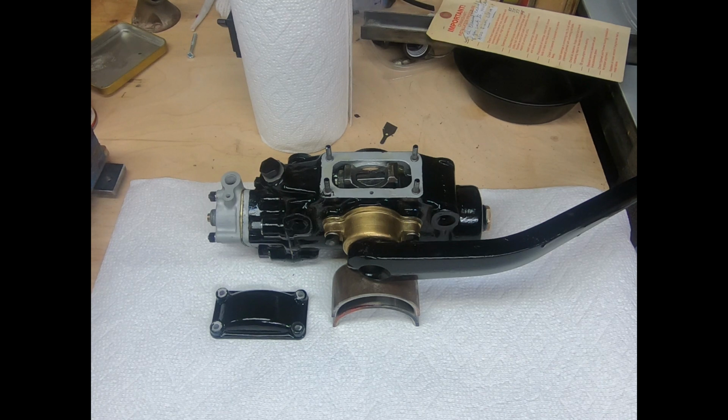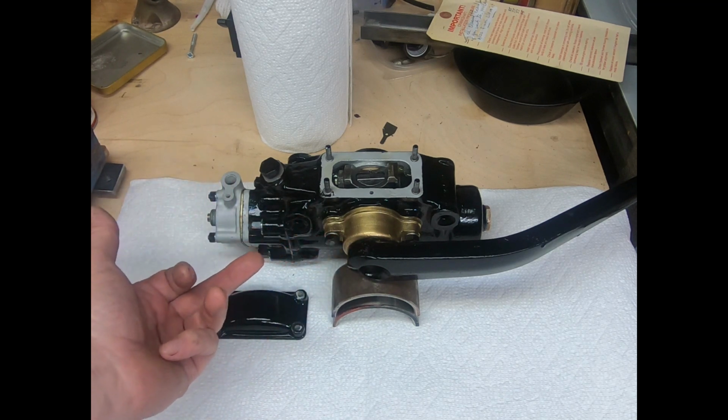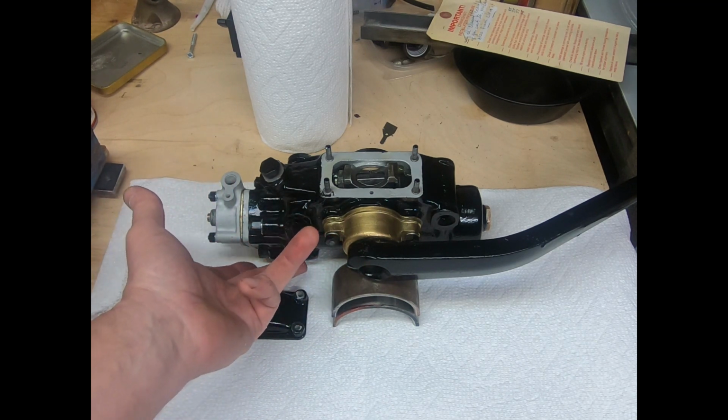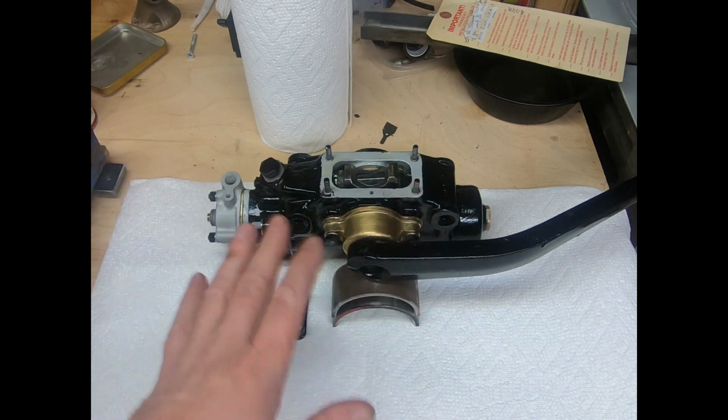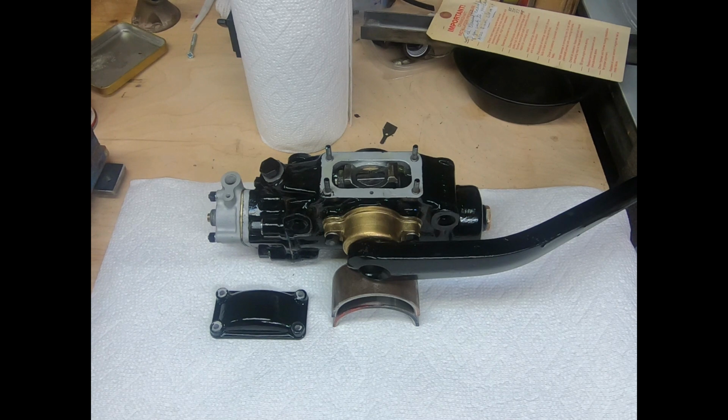Okay, so this is what I mean about having it on a clean surface. So I'll let it sit here for maybe a couple days because I have work to do with the other shock absorber and the bracketry and all. And I just periodically check and make sure that there are no leaks from any of the gaskets or the joints or anywhere. And then when I pick it up, I'll look underneath there and see if I notice any drips on the paper towels.